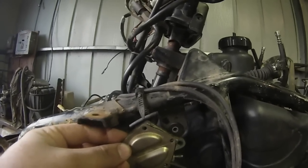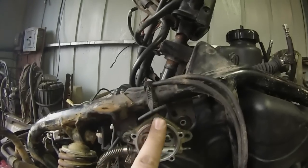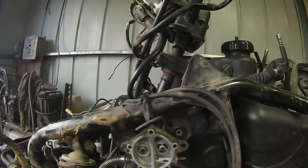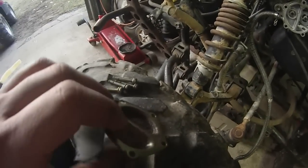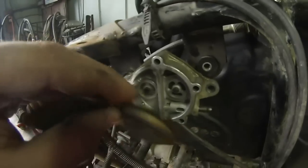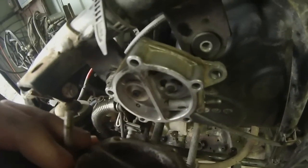You can see there's a ridge that runs up and down right here, and that separates this side from this side when you put the cover on. The problem is there's a ridge in this cover that has to butt up against it and seal off - you can see the shiny spot there where it's supposed to seal. They had it oriented the wrong way, which allows a gap here and a gap here, letting fuel cross sides, which doesn't do any good and won't pump fuel.